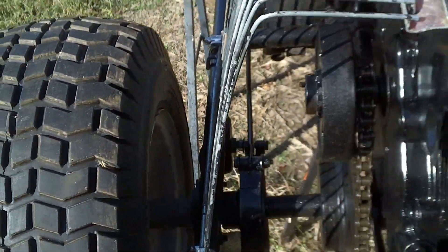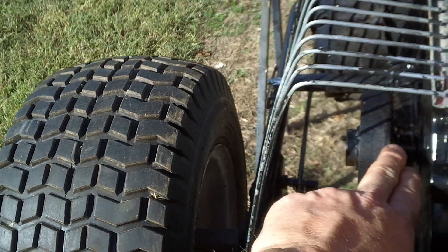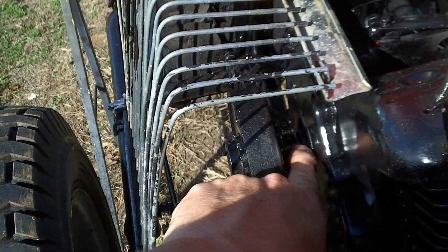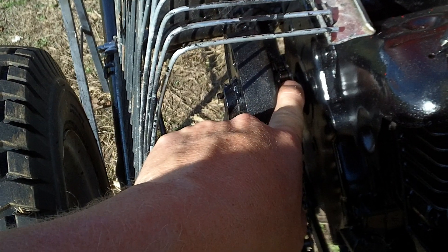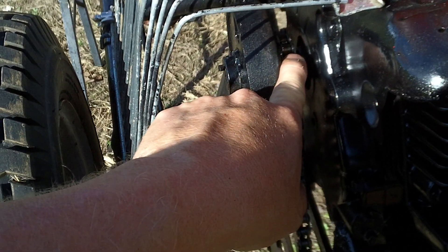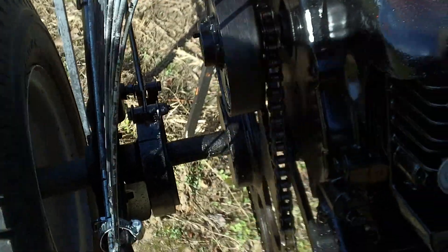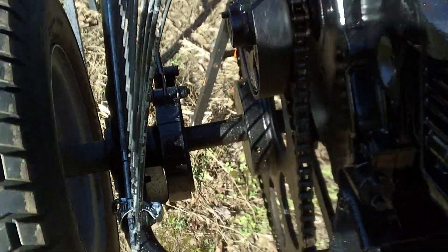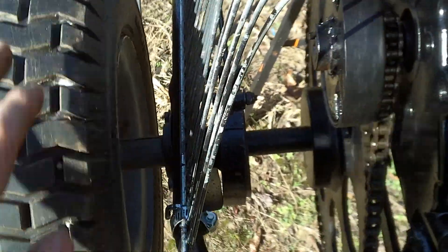The chain is lubed up real well. You lube the clutch right in there — there's a bronze bushing inside and a little circlip up there that can sometimes come loose. I like to lube them with a graphite lube when first putting them together, but here I used a 90-weight. You can hear how quiet that is — all the sprockets are in line, the chain is put together good, no popping, which means the chain is happy and everything turns over easy.